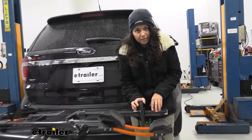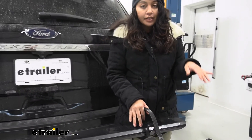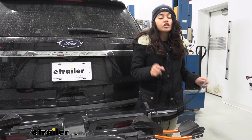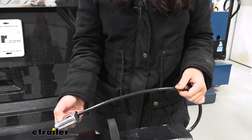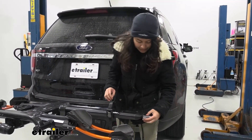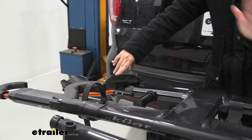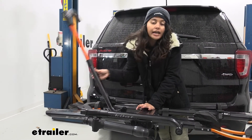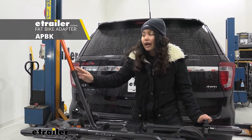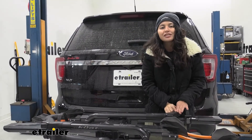With our bike out of the way, we get to take a closer look at the bike rack itself. We have that tray design, and this can move back and forth to accommodate different wheelbases — the maximum wheelbase it can carry is up to 48-inch long bikes. This strap goes down and secures that rear wheel. At the end of each tray, you also have this cable lock that goes around your bike and secures it. All of these locks are keyed alike, so you only need one key to access the entire system. The front cradle has different grooves for different tire widths, so whether you have really thin tires or wider tires, it can carry them. Usually the maximum tire width is up to 3-inch wide tires, but if you do have a fat bike, you just need to get the extra strap adapter and then it can carry tire widths of up to 5 inches. The front wheel cradle ratchets down to secure the front wheel, then folds down to be nice, neat, and compact.